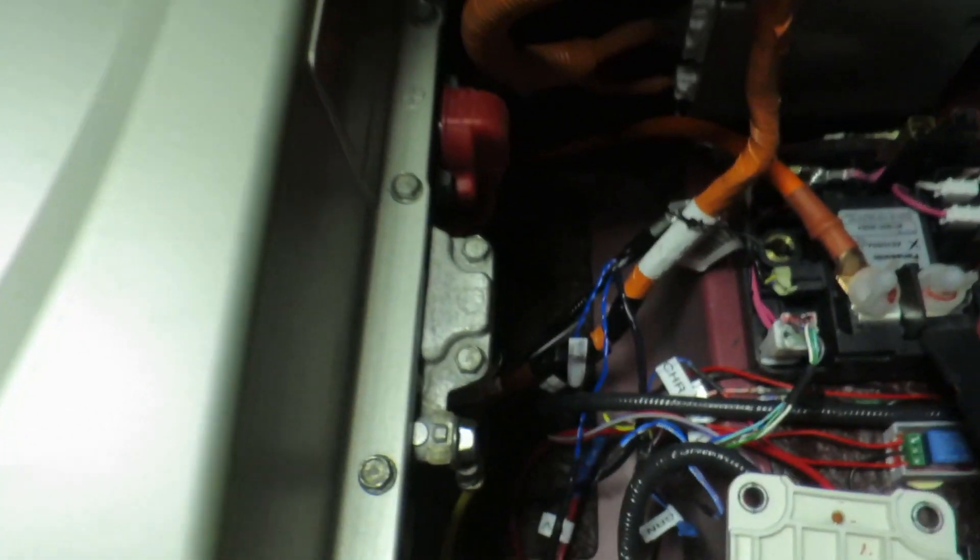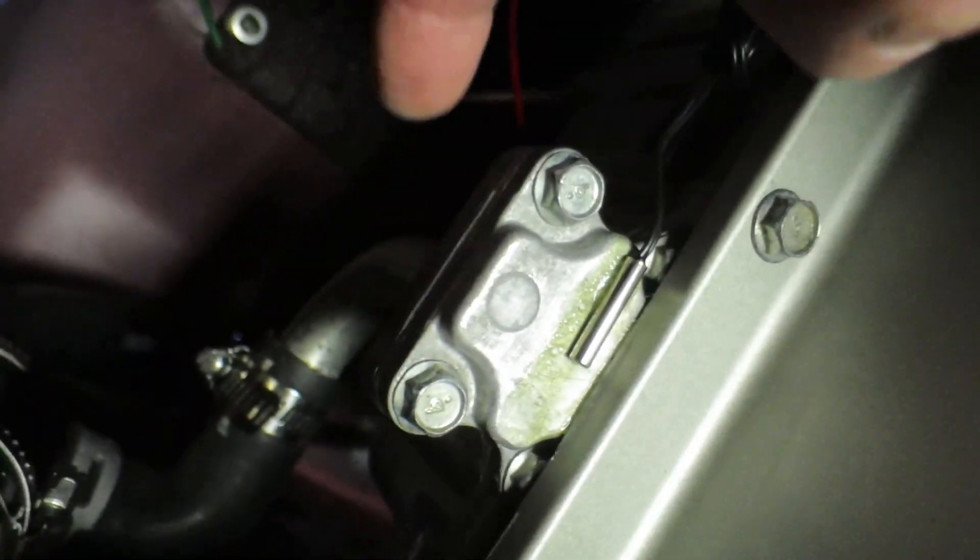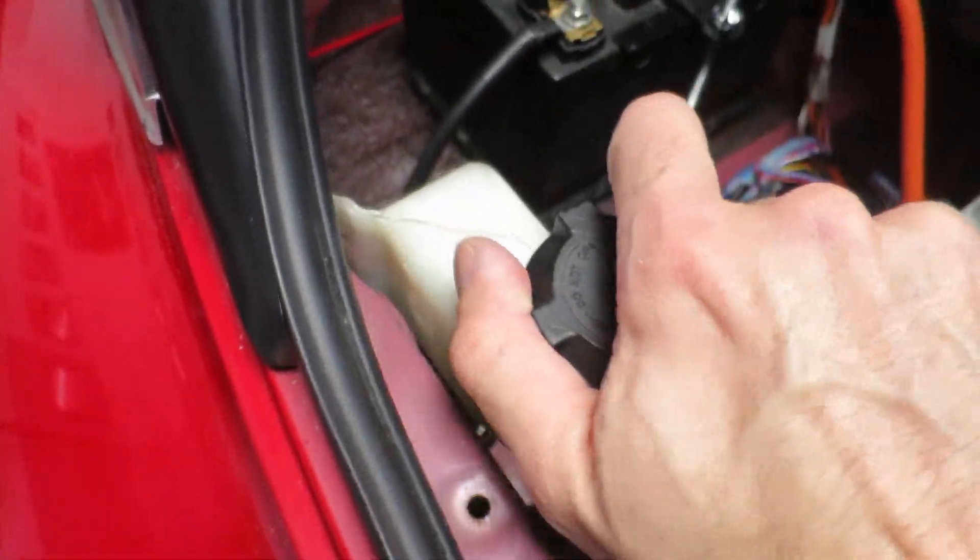There's an exit for water here so I've got a hose going down, and coming round here I have a hose input with a little T-junction and a header tank that came from a motorbike — that's full of water — and then that pipe runs down through the bottom of the car. The RX-8's got quite a nice well here, which is handy because if these leak they're going to leak into the well. It's a homemade cooling system so it did leak quite a lot when I was building it, but it just leaks onto the floor — it won't affect the high voltage or the low voltage system.